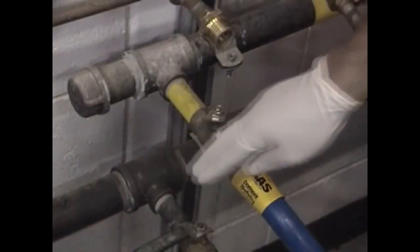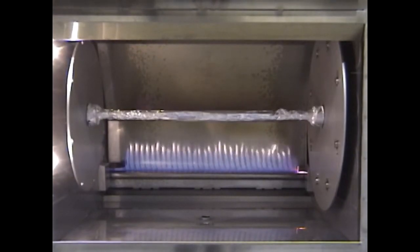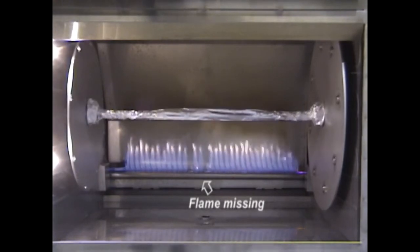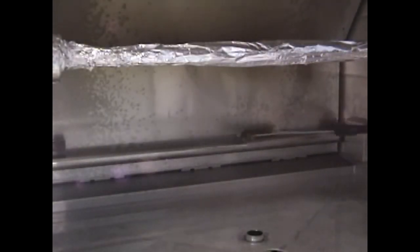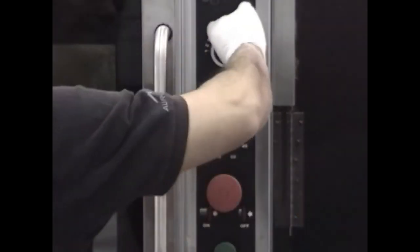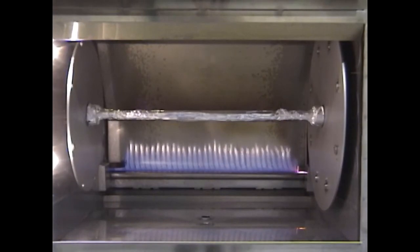Reconnect the electrical cord and open the main gas valve. Set the thermostat at 7 and the timer for 5 minutes, then pull the red button to start the unit. While standing in front of the rotisserie, observe the burner ignition process and verify that the flame is carried all the way across the burner tube. If the flame is not carried across from one side to the other, verify that the burner holes are open at the point where the flame stops. Close the main gas valve and disconnect the electrical cord; allow the burner to cool. Then use a paper clip to unblock and clean the carbon buildup inside the blocked burner holes. After opening the holes, use the bristle brush to again clean the top surface of the burner and ensure no deposits remain. Wipe clean the water pan prior to ignition. Reconnect the electrical cord, open the main gas valve, set the thermostat at 7, and the timer for 5 minutes. Pull the red button to start the unit and watch that the burner lights evenly across its length.